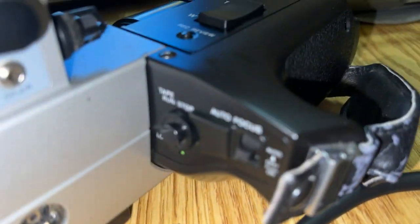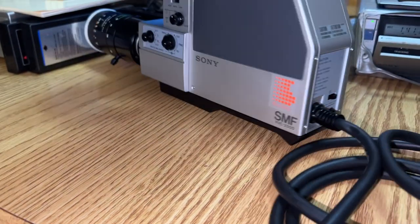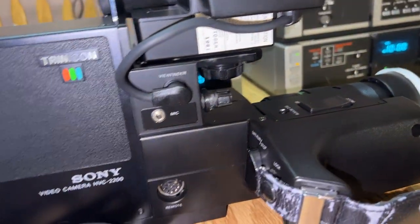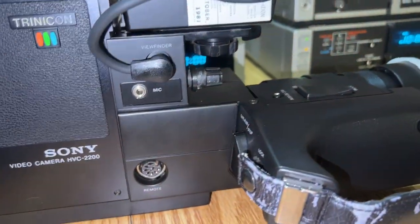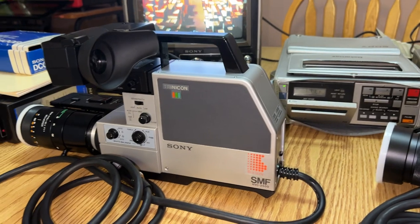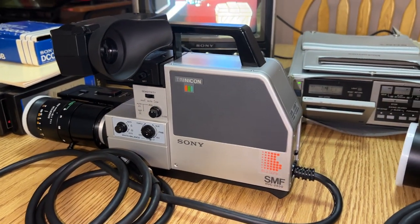The HVC-2500 has autofocus and everything. For the viewfinder, you have indicators in there. It did work last time I tried it, and now it's kind of working again — it looks brighter on the camera than in real life. When I shine a light at it, it's nice and bright. But last time I used this I couldn't get any luminance — it just had color blotches. Now it's working. It's weird. I plan on making my own battery packs for these so I can get them portable again and actually use them.